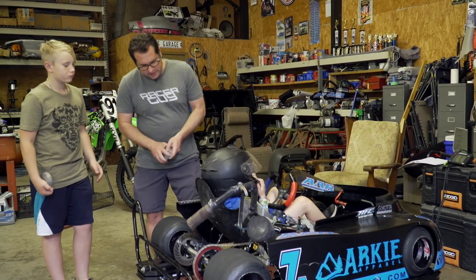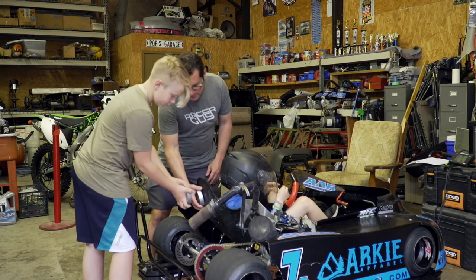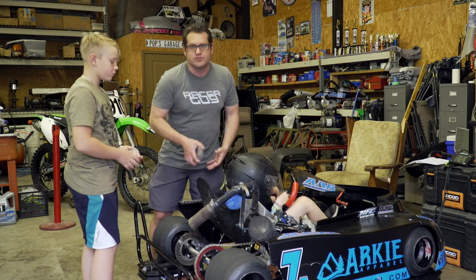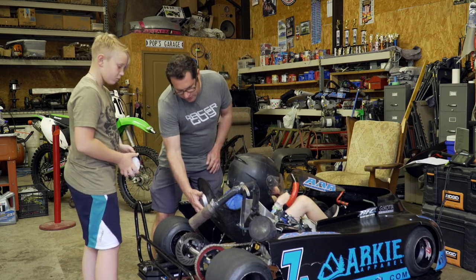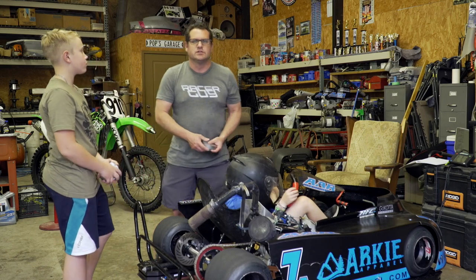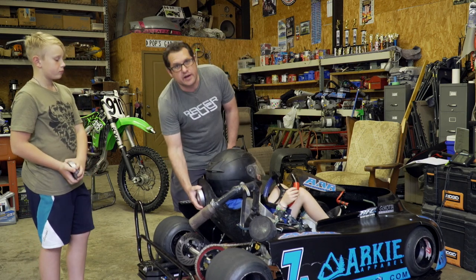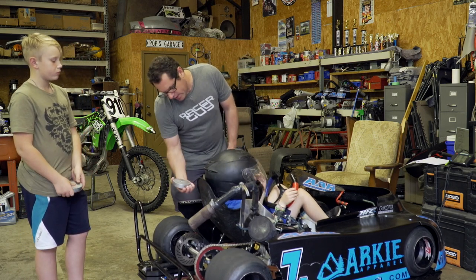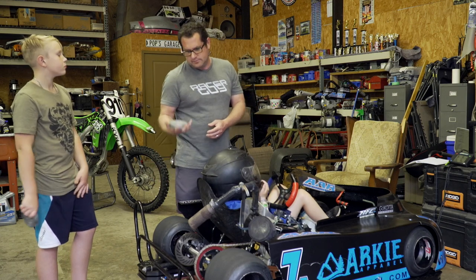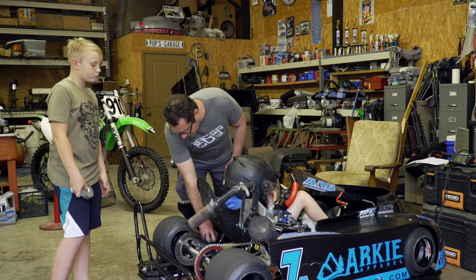So what all we did was we're going to probably mount about five to ten pounds here. Ten pounds puts them up to almost 54% back here, and that gets the weight up higher, so you're going to get more weight transfer to the rear tires. You could even do five here, but we'll probably do ten — just depending on track conditions and what we're looking for. If the track's got a lot of grip, we might take five pounds off here, maybe leave it right here.